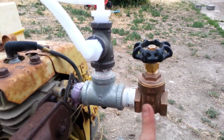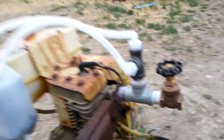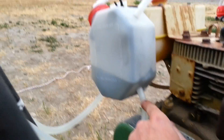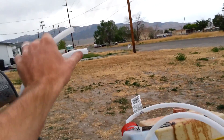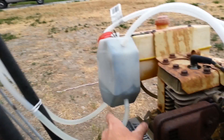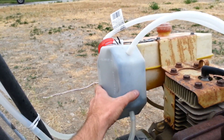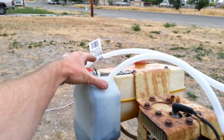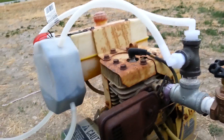Here's my secondary air intake — that will control the air-to-fuel ratio. These right here on the bottom are the air intakes to the vaporizer, and I have them clear up here above the container, as you can see. What that does is the air will be sucked through these two tubes, go down, bubble through this gasoline, and be filtered out through the stainless steel wool, and then come through these tubes, mix with more air, and then go into the engine and it'll run.